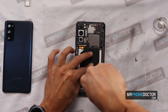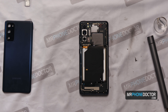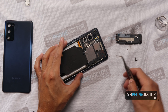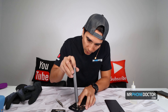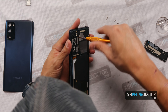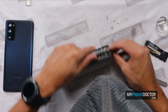These screws seem pretty tight, so I'm going to manually remove them first. Looks like all these are out. Let's go ahead and remove the back plates. We got the lower back plate here — this one covers the charging port. This upper one looks like it got cross-threaded; when they put it in, they put it in at an angle and it's not right. We were able to get that stripped screw out. I just want to show you guys the back of this phone — you can see how the quality on this is a lot less than what the S20 Ultra is.